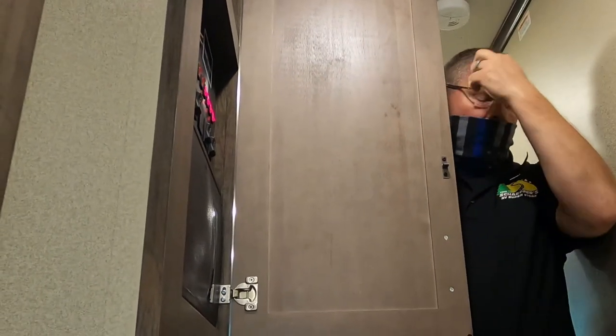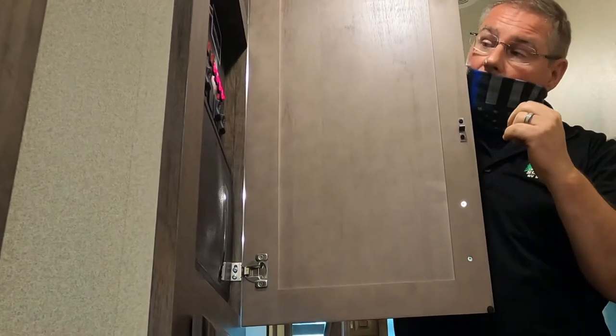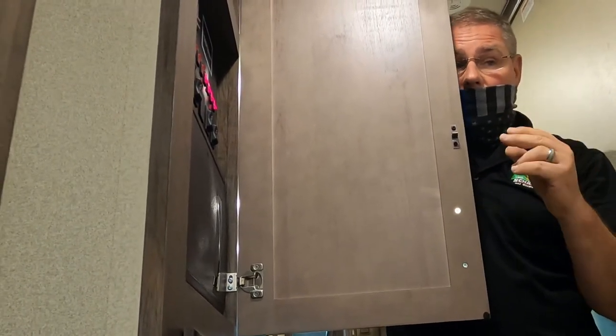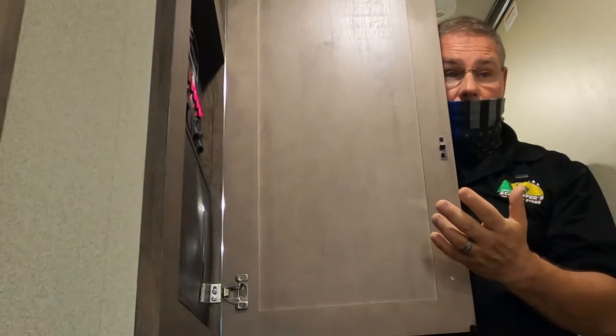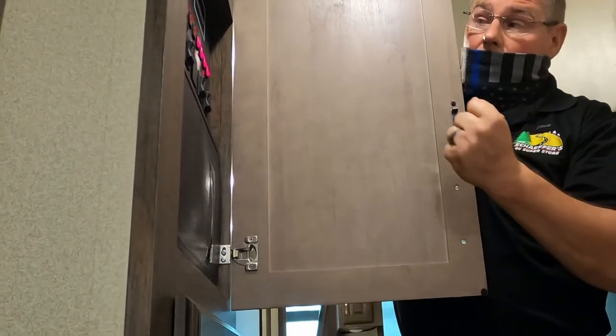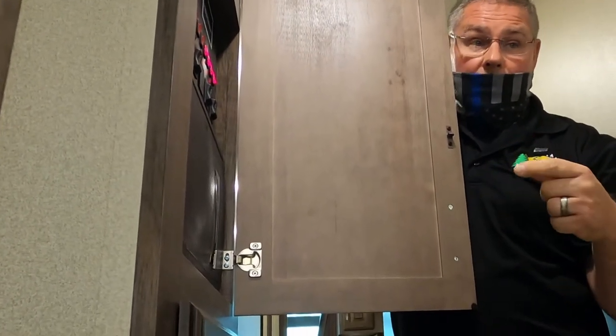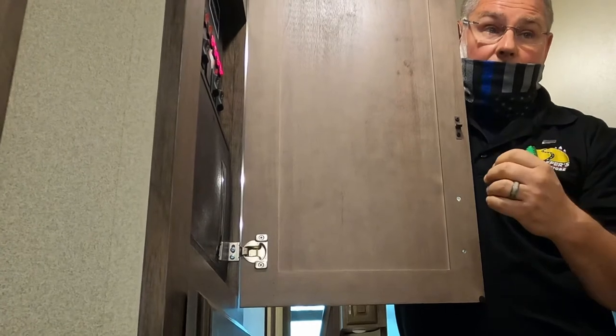If it still fails to fire up after you've troubleshot, campers are telling me that box elder bugs and stink bugs like to make their home in the burn tube. The burn tube is where you saw that blue flame. You need to blow them out. Spiders love the taste of propane. They'll build nests around that venturi tube. You need to brush them off.